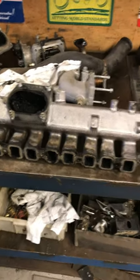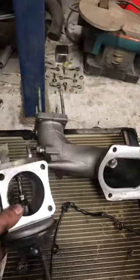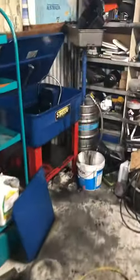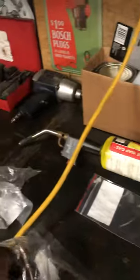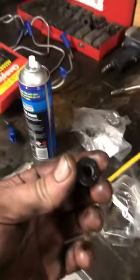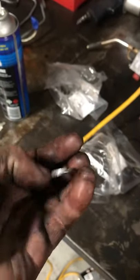That's how you get into the dog, so we'll give all this shit a clean and put him back together — that's the intake clean. I'll give everything a clean. There's the EGR intake manifold part — it was a dog to clean, I'm not going to lie. Have a look at the fucking mess I caused here cleaning it — it's a sludgy shit to get out. I've just put a new gasket on there and sat it on to torque it up — 20 newton metres I think it is. And don't forget the little rubber-coated washer things — eight dollars each from Toyota. Fucking rip off.